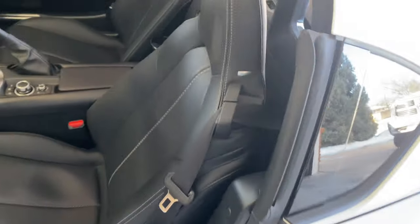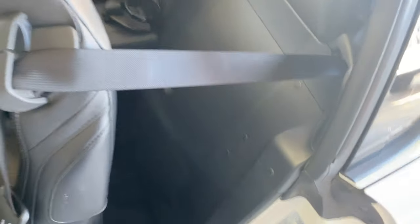Now with the top off, that gives us a little extra room. We're going to open the back seat as wide as it goes and move the seat forward as far as it goes to open up the back space. The action is going to happen right back behind that panel. Per the instructions, the next thing to do is pop the hood and disconnect the negative battery terminal.